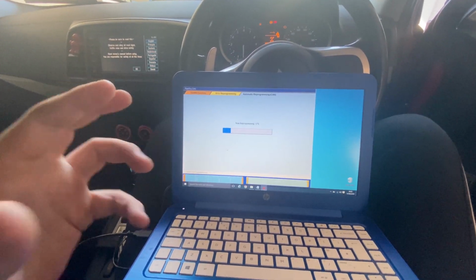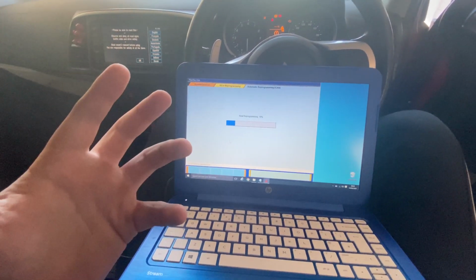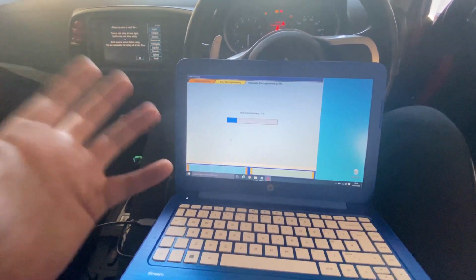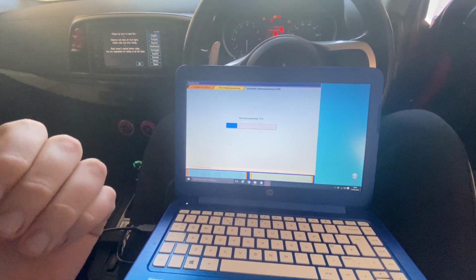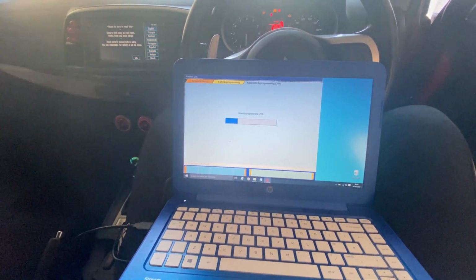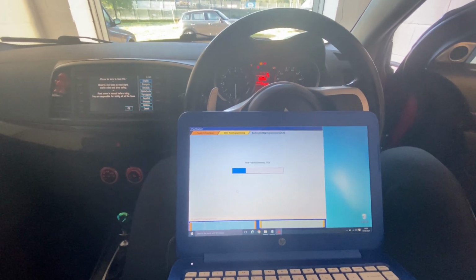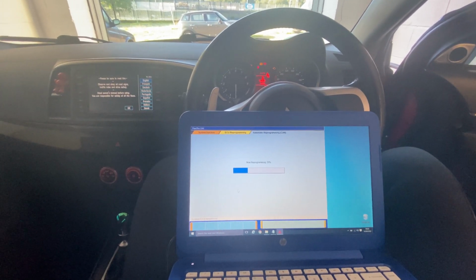Now, last time I spoke to Chris, I'm sure he said he wasn't sure whether it had proper Diaqueen or Transmax dual fluid put in it at the last service. This is the importance of having someone who knows Evo 10 SSTs, because when I drained the gearbox, there was only 5 litres of oil that came out. There's supposed to be 8. So that does show really that whoever had done the service before, they hadn't put the correct amount of oil in. There are no leaks on this car, so there's no way that 3 litres has disappeared. It just wasn't put in the first place.